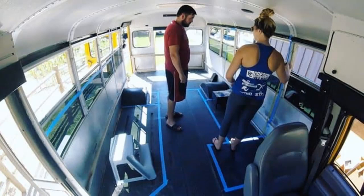There were some techniques that helped us avoid more mistakes like that. For instance, we taped out our layout with painter's tape once we had removed all the seats and the wheelchair lift. This allowed us to walk around in the space and visualize more clearly how much room everything would take up and whether we would be able to maneuver around inside the bus. We also talked things out before making any major moves, and between Aaron, his dad, and myself, we usually found any glaring errors before we made them. And as with any type of construction, we measured twice — or more — and cut once.